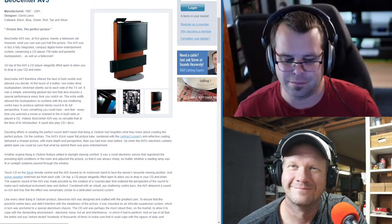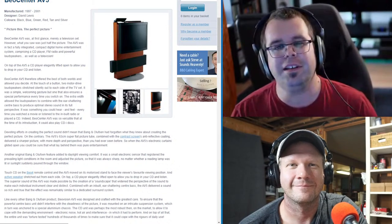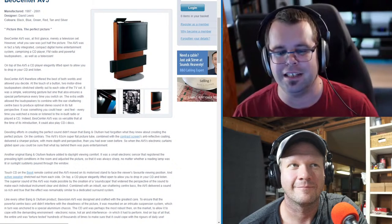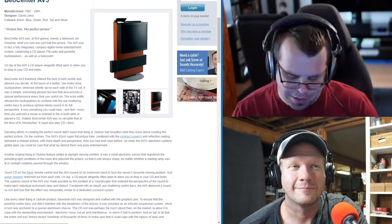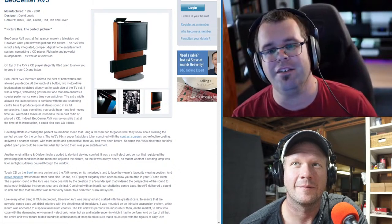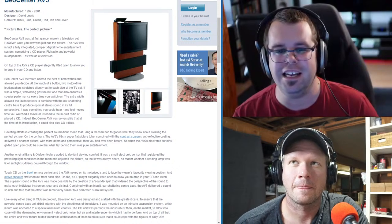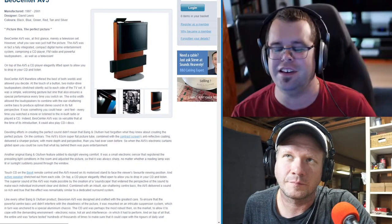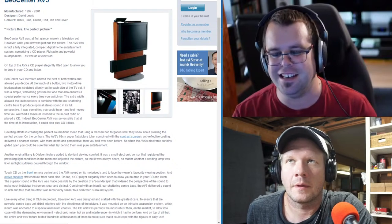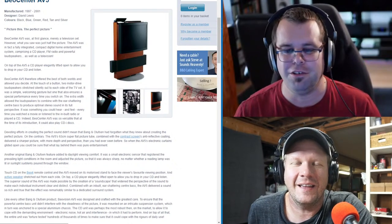Well, this unit played CDI games, and I quickly discovered in the service menu, which you access by hitting menu 00 and then OK. You write into the service menu. There you go. On the newer B&Os, it's simple. There's a CD option. You go down there and it's like CD mode, audio or CDI. You just set it to CDI and now the CDI player works, but you're still missing those controller ports.